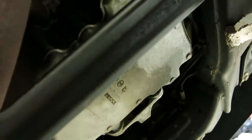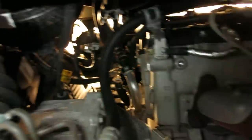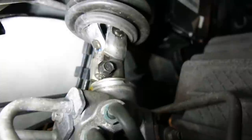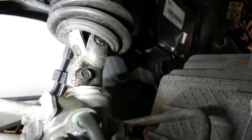I should mention that I've never done this before, certainly not on this car, so I'm kind of learning as I go along. It's showing up under that boot right there — that's the nut we have to take off, then slide the intermediate steering shaft off the steering gear. Although you could reach in there with plenty of room to get your hand on it, it was a little tricky to find tool access to get it off, so I'll share how I'm approaching this.